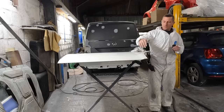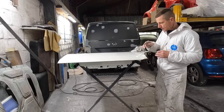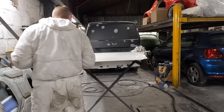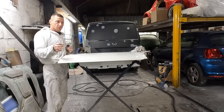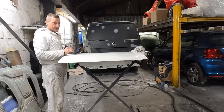We had to bare metal from the bottom up to the swage line - it's covered in stone chips. Those chips have grown into rust patches. Not rust patches that are concerning, not like the door's going to fall in half needing welding, but if we didn't save them now they might have actually turned into that. They're little chips, little rust patches, a few dents.